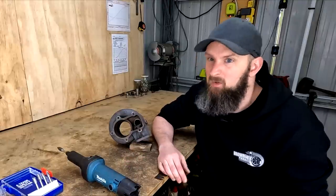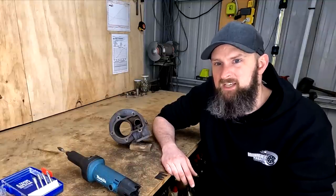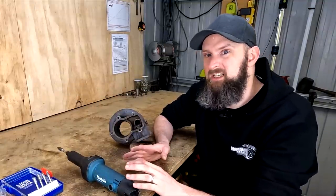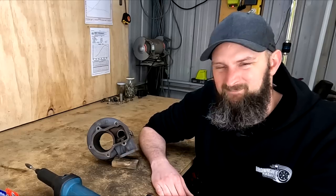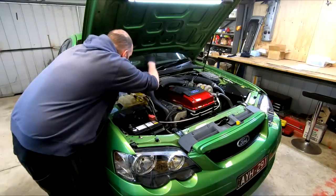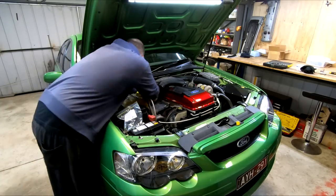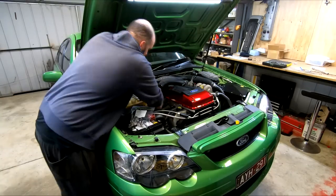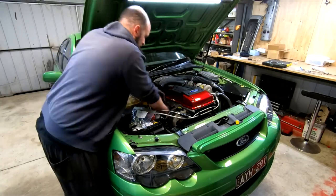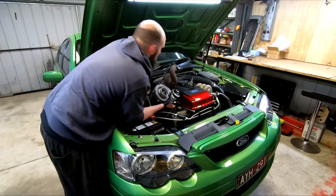The porting will be the fun part, but unfortunately we've had to tear the car down a bit to do this job. I won't go crazy on detail here — it is fairly simple unless you hit a rusted bolt or a rounded head. The easiest way of removing the turbo is to pull it out attached to the manifold. Remove the intake and intercooler piping, heat shields — the stock dump can stay on but disconnect the exhaust after this. Oil, water, and vacuum lines come off, and don't forget to unplug the oxygen sensor like some hack YouTube guy did last time. Then undo the manifold bolts and work the whole thing out.